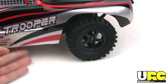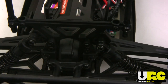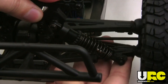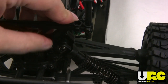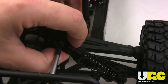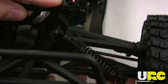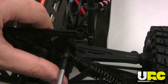While fiddling with the suspension I also stood up the shocks by moving them out one hole on the shock tower. When I went to do that I noticed another assembly issue — up in the upper mount they were tightened up too much, so they were actually binding. By turning that out just a quarter turn, allowing a little bit of gap like they're supposed to have, it completely frees up the suspension — just a tremendous difference. It's very important to go through all the hardware on this truck and make sure it's not too tight and not too loose.